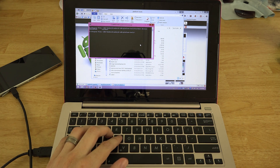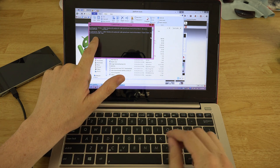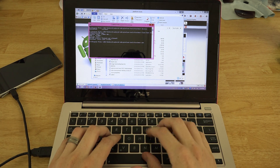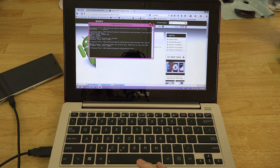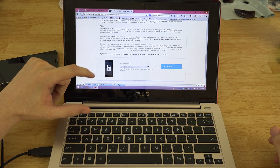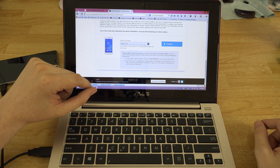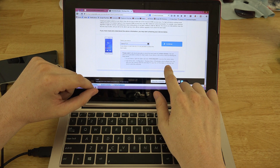Volume Up, plug in, blue LED is on. Back in the platform-tools folder we right-click 'Open command window here' and run 'fastboot devices' — there's our phone in fastboot. We paste the flash command: 'fastboot flash boot boot_z3' Tab to autocomplete, Enter. It says 'FAILED: command not allowed' — our bootloader is probably locked. We try 'fastboot oem unlock' and get 'incorrect format for unlock data.' There's more to this than we thought.